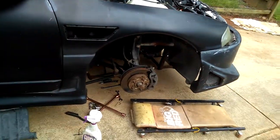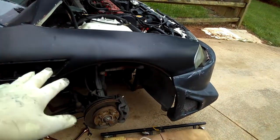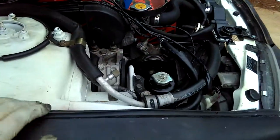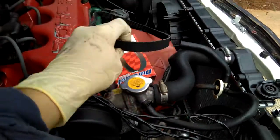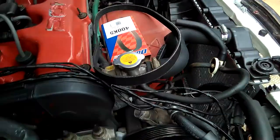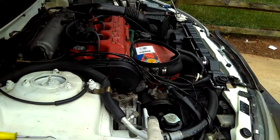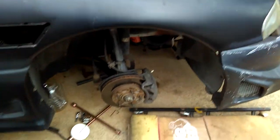So this is what's happening — the alternator belt is loose and ready to be taken off. I've had the power steering belt taken off and it's ready to install the new alternator belt. I got it from Motor Zone and they got me the right one. I already tried it and it's about the same size, going around the power steering and the crankshaft pulley.